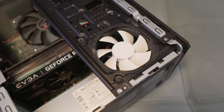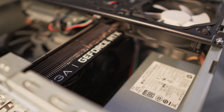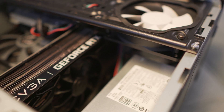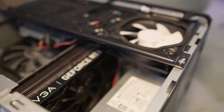After I cut that hole, I applied some rubber U-channel around the cut. This rubber U-channel is a very common thing among people who were modding back in the day, especially when there weren't many cases with side windows. One person I always like to buy from is Bill from MNPC Tech — I always order my U-channel from there whenever I do modifications. You can see the link down below the video. I used just a very little piece around the rough edges of the cut. Even if you file it down smooth, applying that U-channel around the cut and then installing the fan makes it look nice, clean, super perfect.